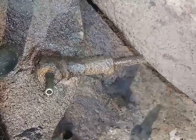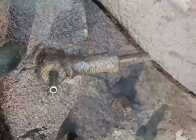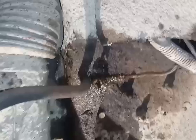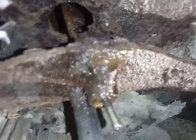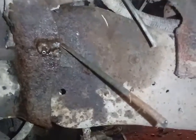That line doesn't look like it's going to come off — it's pretty corroded. I might end up just flaring both sides. The penetrating spray can was nearly empty — somebody dropped it and put it back on the shelf. We had to cut it because it was twisting; it froze inside the nut but the nut did untwist, which is good. Couldn't get to the backside fitting either so we just cut it — we'll reflare both ends.